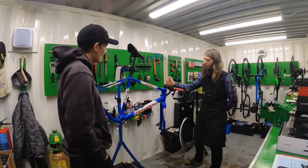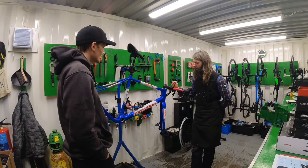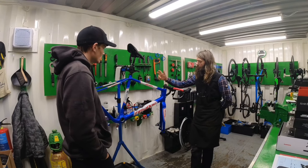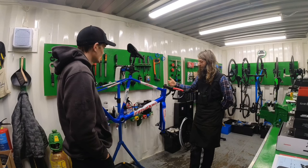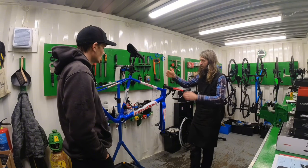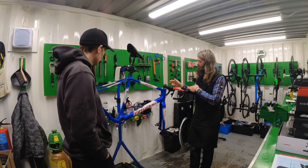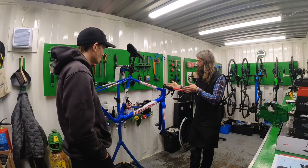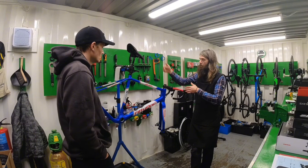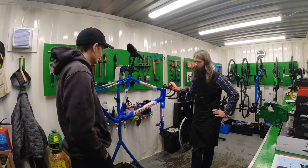Oh yeah, so really unique thing with 51 is they've followed a little bit more of kind of mountain bike design. It's a longer top tube intentionally so that you can run a shorter stem, which keeps the geometry the same, so your reach is going to end up being the same. But it means that the front end of the bike handles much more quickly, much more agile. Shorter stem, narrower bar, which is the way that everything's going. But you keep the reach in the frame, so they've intentionally moved that to make it more agile.